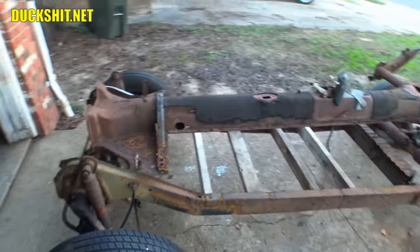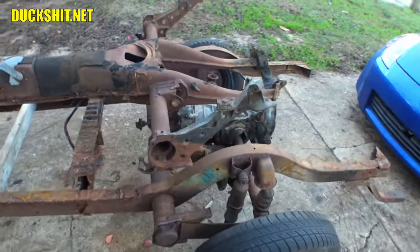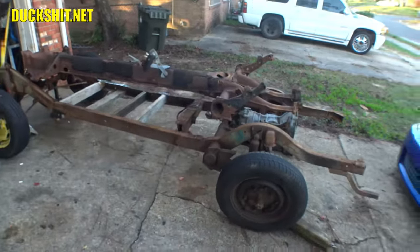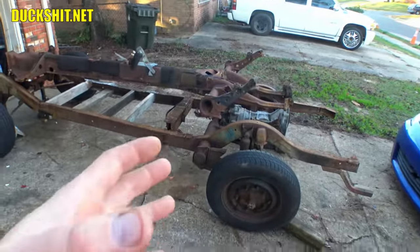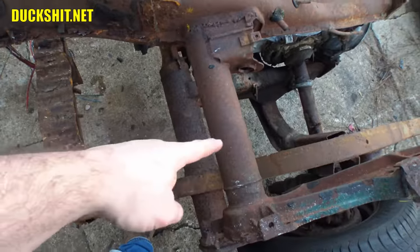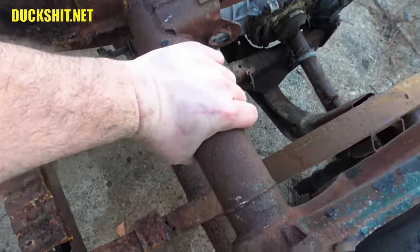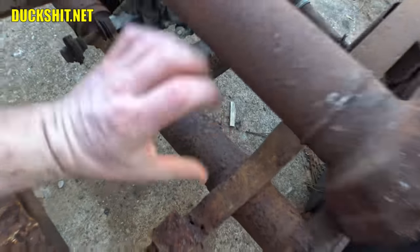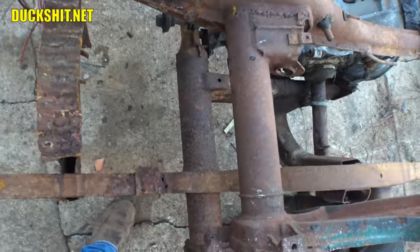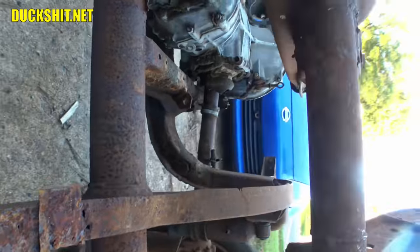Now that I've gotten to see this for myself — because this is the first time I'm looking at it too — I'm impressed that Volkswagen engineered everything to be the same wheelbase. Everything's in the same geometry, just the same. The only difference is the bus stuff is clearly beefier. Look at the torsion tube — you probably can't tell from the camera because of perspective, but there's my hand wrapped around it and my hand wrapped around that one. There's like a one-inch or more difference in the torsion tube diameter. It's funny how the camera makes them look the same size. But they're not — not at all.